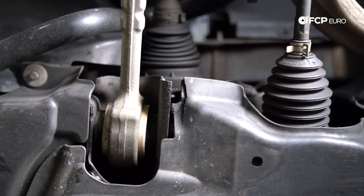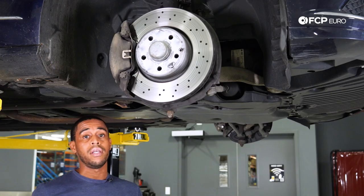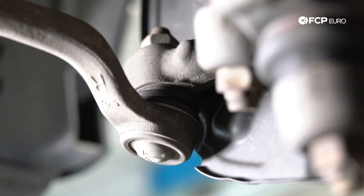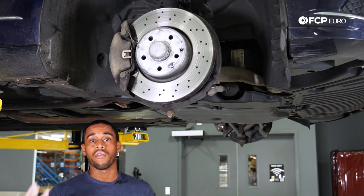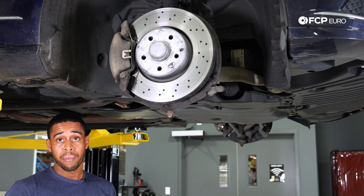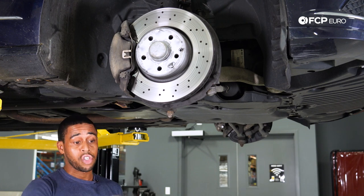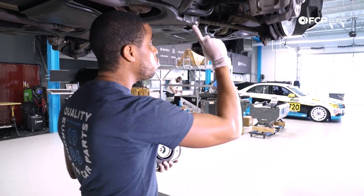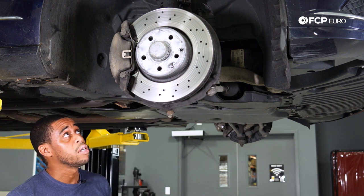And then lastly, you have this control arm here. You're going to use the same type of maneuver to look at the condition of the bushing. Additionally, if you have a rear-wheel drive model, there are going to be some small differences — at the knuckle you're going to have a ball joint, and instead of the ball joint being integral to the control arm, it's going to go into a separate bushing at the end. Same basic principle at the end of the day regardless of rear-wheel or all-wheel drive. Regarding the shock absorber: if you are driving very harsh over bumps and the vehicle is kind of self-steering, the strut is probably blown out. When you replace the strut, you're also going to want to replace the upper strut mount — you've got rubber in this mount and a bearing that allows the strut to swivel. The ones we sell are inclusive of the bearing whenever you replace your strut assembly.